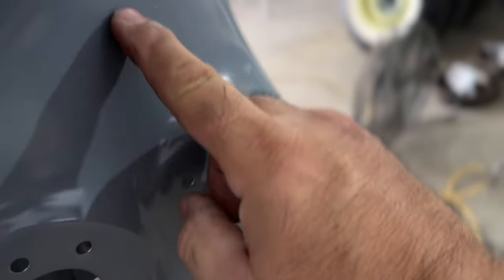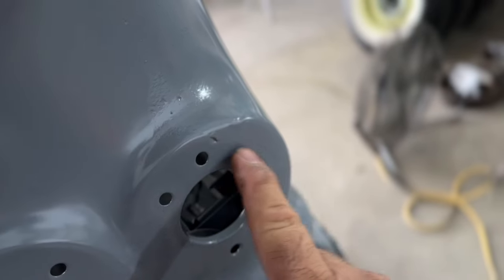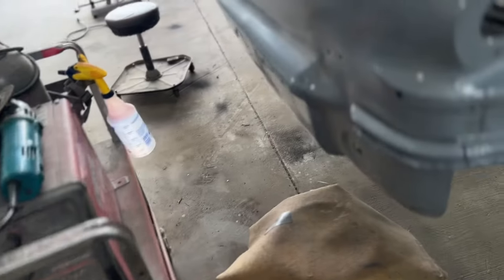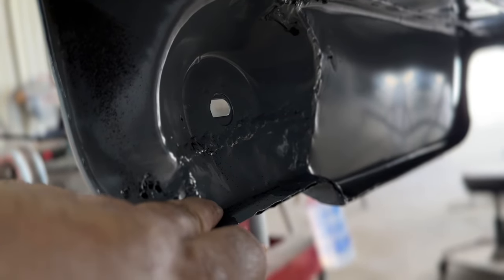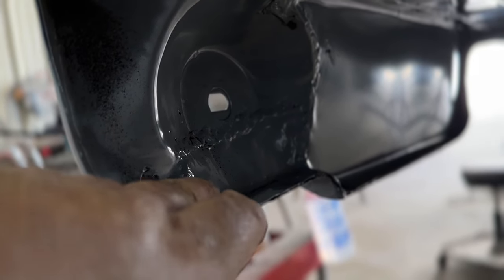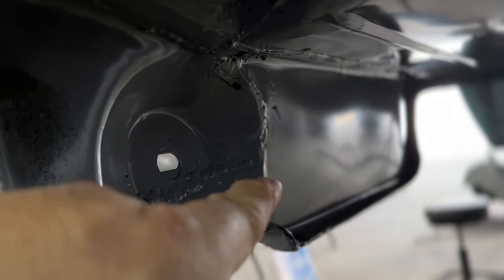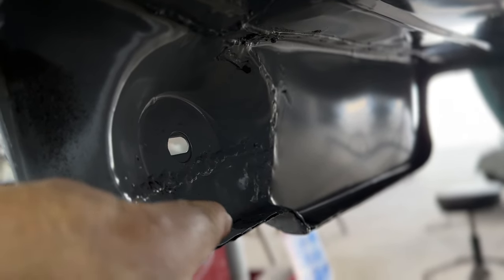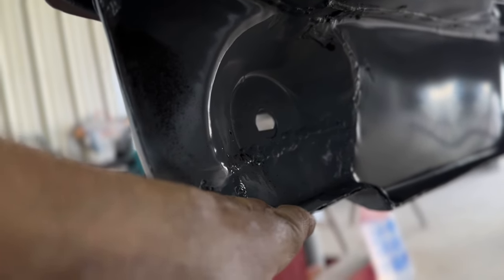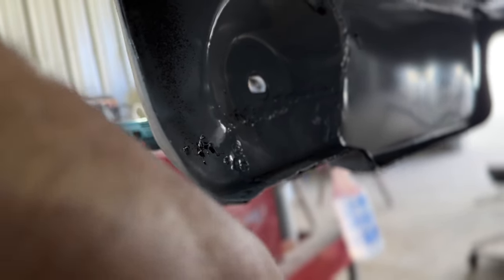There is some lead right there because there's a body seam that goes down right through here, but it's not pulled in. And then if you look further, somebody did a bunch of patchwork in here, where they just laid sheet metal over the top of this stuff. And even that inner section right there is all brand new sheet metal, and they just kind of fudged these. That tells me that this thing was pretty damaged, because it's all kind of Frankenstein together under here.